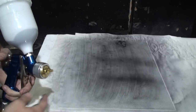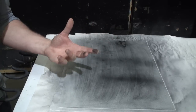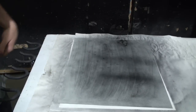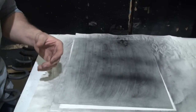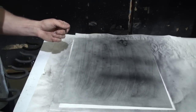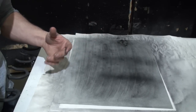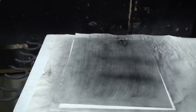You'll notice it's very lightly covered at this point — it's got kind of a mottled look to it, and it really doesn't look like I've coated it. That's something that's tough to get used to with acrylics, but that's actually what you're looking for. You're going to do four, maybe even five coats, so you want to get them all on very lightly. This stuff doesn't have chemical adhesion properties, so you don't need to lay a whole bunch of solvent on there to make it stick — and since there's no solvent, I don't have to wait ten minutes to spray again. I can go ahead and do it right now.